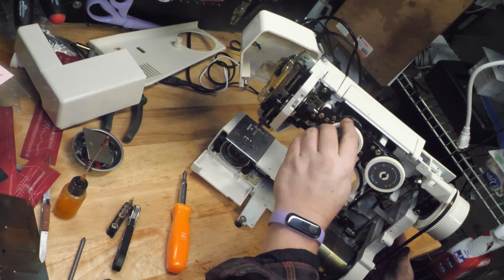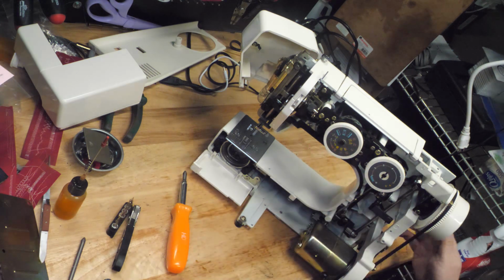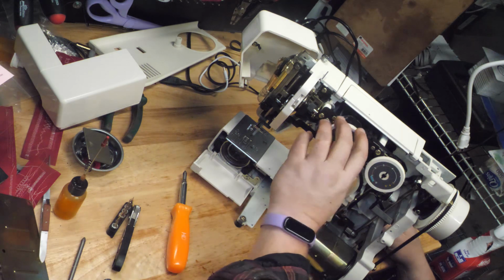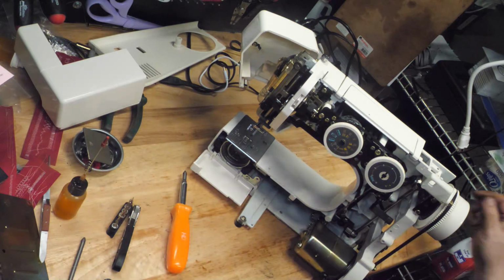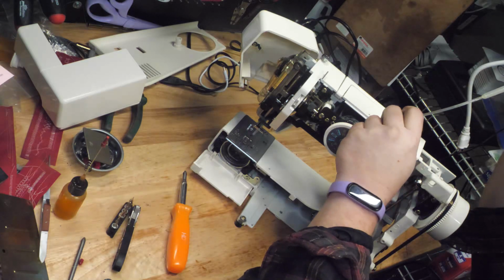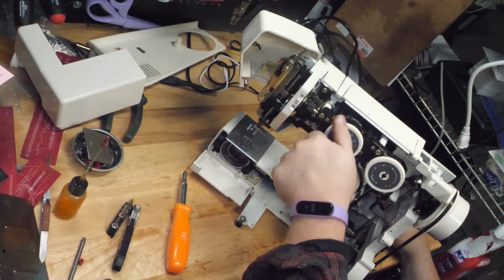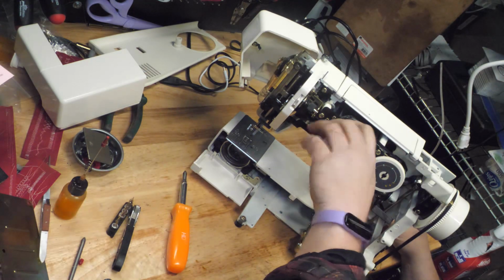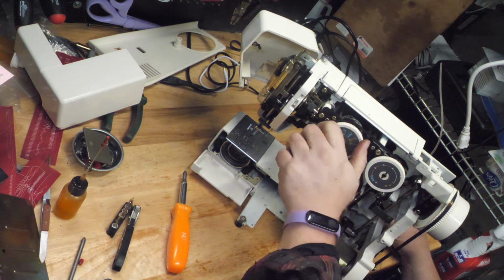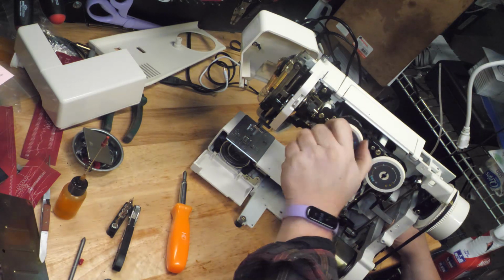And I am just moving it, and it's sluggish but moving, so that's good. The cam follower is sluggish but moving there, so we'll just have to put a dab of oil on the track in there. And then turn our knob and let that slide around a bit. That'll free up and start following faster.